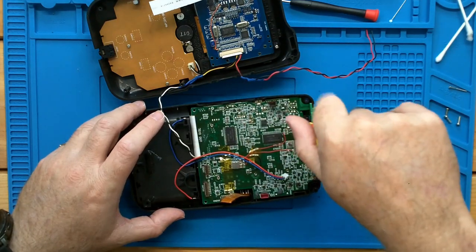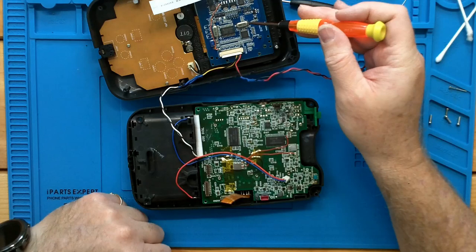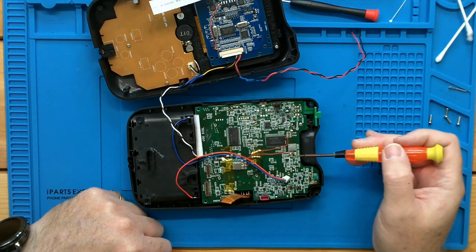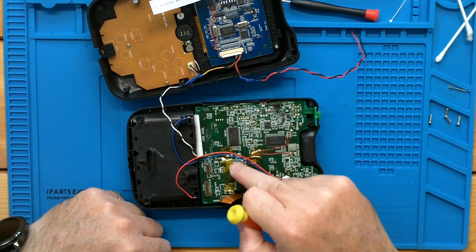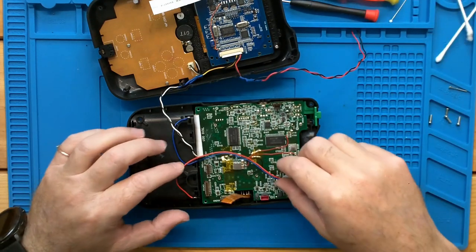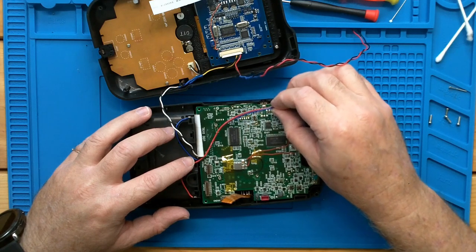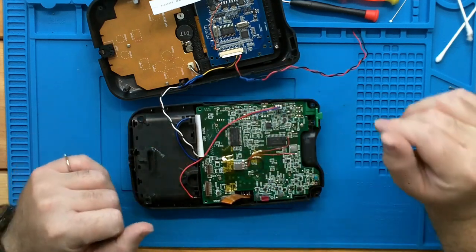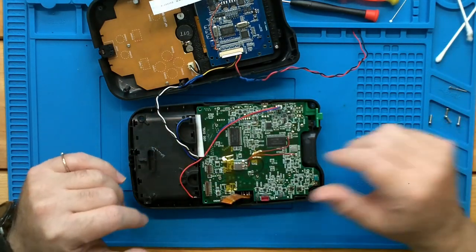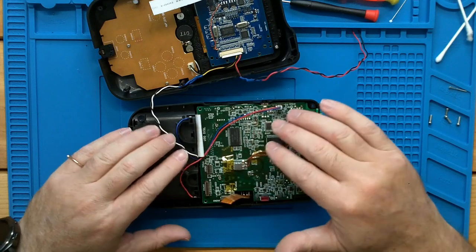We decided not to put the shielding back on the main board, because we needed the extra room potentially for our driver board for our LCD. And of course we have the video mod on the other side and a new regulator on this side. So I felt it was probably best to just go ahead and leave those off. Not to mention it will help with any kind of cooling that may be needed with the new parts. Although I let this run for about an hour and a half to 2 hours on the bench just to make sure there were no issues, it's always best to lean to the side of caution. We know that this board doesn't put out much RF, so we're good with this mod so far.